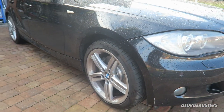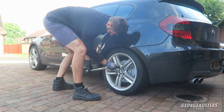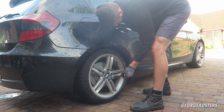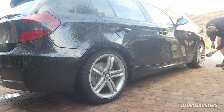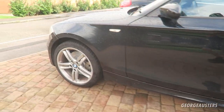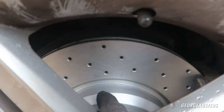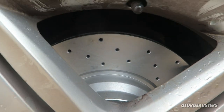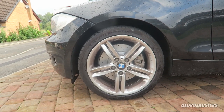The car is back on the ground of course. I just need to make sure I torque all four wheels down now. Okay, so that is all of the wheels torqued back up. Now, because the discs themselves are coated to prevent rusting, obviously this part will remain coated, but the face of the disc - that will come off when I start braking. So I'm going to take it for a test drive now, just to make sure everything is working as it should and to bed the brakes in a little bit and get that coating off the face of the discs.